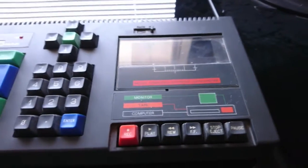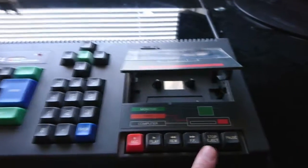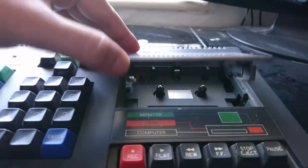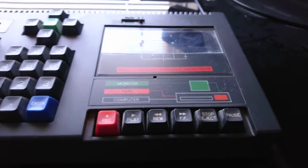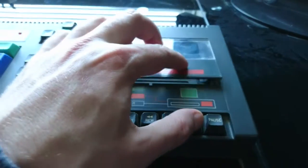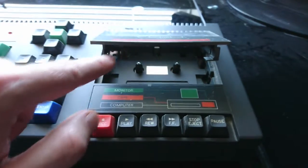But also back in the day, what also went on this was when you push eject, that's quite a fast eject mechanism, and that inside is only plastic. It's starting to squeak already. So my tip is, because that's only made out of plastic, this eventually will break. Back in the day mine did. So my advice to you, if you own one of these machines, or in fact a ZX Spectrum 128 Plus 2, because they were made by Amstrad too, when you push the eject button, just make sure you keep your finger on it so it doesn't flip up, and put no damage and no strain inside where the rails or whatever they're called can snap.